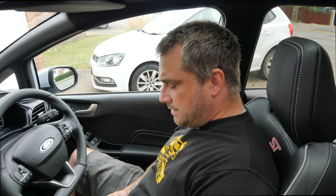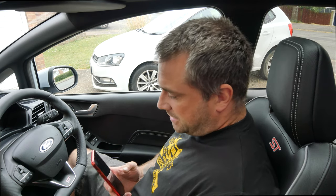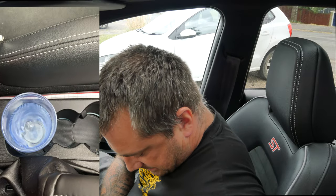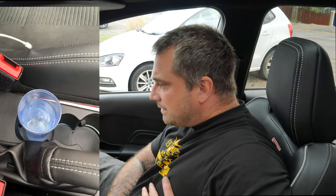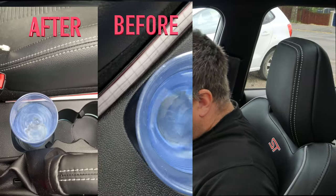We're back in the car. I'll do a start-up test now — I've got the water back in the same place as before. This will hopefully give us a rough idea of the vibration difference. I can definitely notice a difference — I can feel a bit more vibration on tick-over. We're still on cold start at the moment. I'll try to put these videos side by side before and after to see the difference. The revs are now coming down — it's made a massive difference just by coming off cold start.